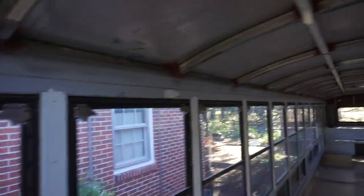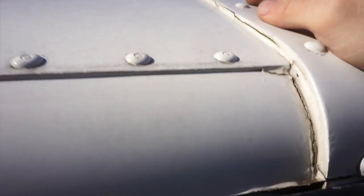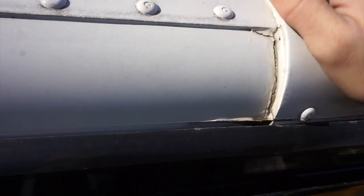Now I think it's time to start with the outside. We've got a bunch of leaking on the tops of these windows on both sides. My first suspect is this drip rail — it just seems to be a really bad design. Look at that transition, there's a big gap right there. You can see a long time ago they had this silicone. Seems like the only thing about this bus that doesn't make any sense.